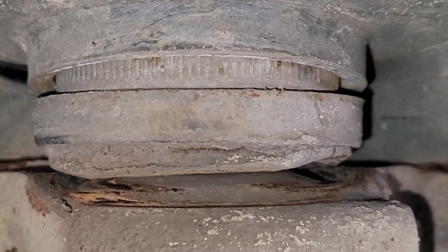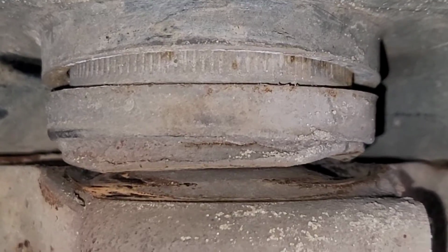Now the only other choice, because they don't use this thing on the road all that much, is I could put a ball joint in this. And like I said, this truck is really not used on the road. This is the only time I would even recommend it, not even recommend it, I don't recommend it. But because it's not really used on the road, except to come here or to go get gas, that's really it. I may be willing to take the ball joint out, put the new one in, and weld it in place. I usually only do that on an absolute emergency basis, or a situation where a car is not even registered. I don't even know if this car is registered, to be honest with you. It might not be.